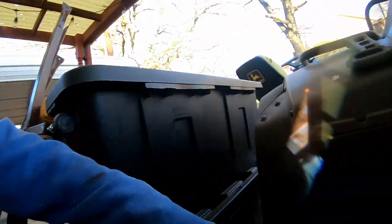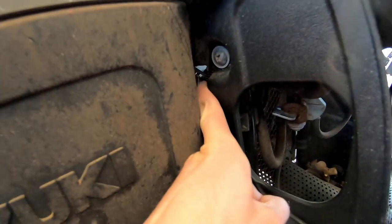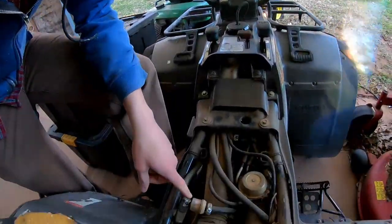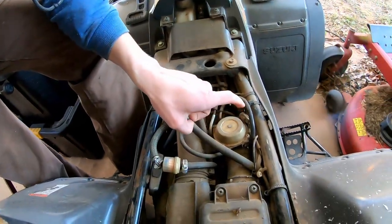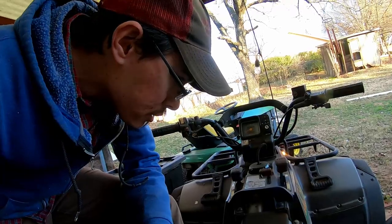Then we also have a fuel pump, which you can't see, but the fuel line comes out of here and goes up somewhere. Yeah, see, there's another line coming back down. So the fuel pump's buried up somewhere in the front end. And the fuel pump again runs off a vacuum, so if we don't have enough vacuum, it may not pump enough fuel. From there, the fuel comes across into this filter, which is basically just being used as a splice here, and it goes into the carburetor. I think we already had another filter somewhere else in the line.